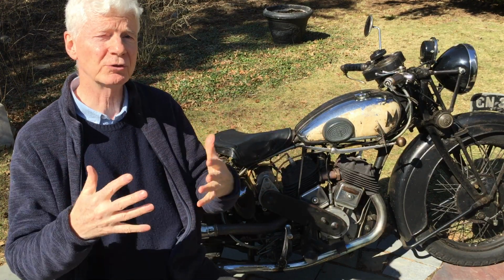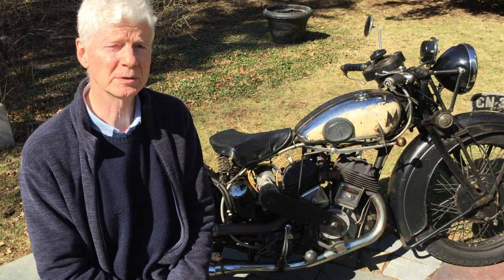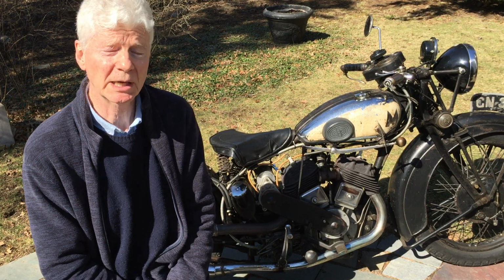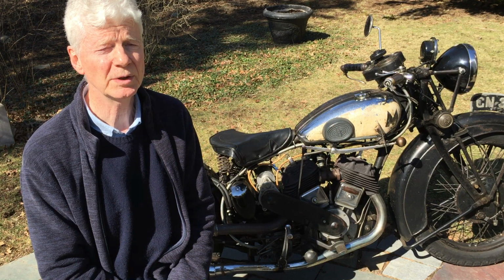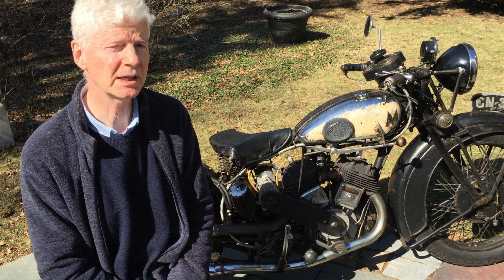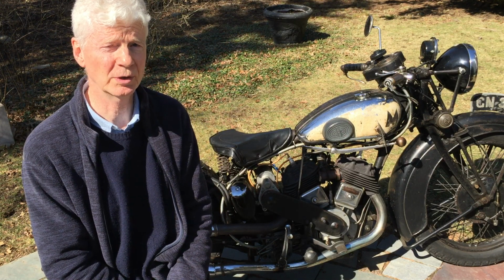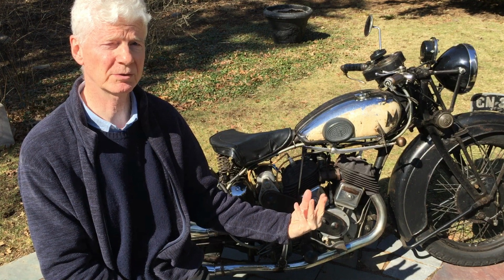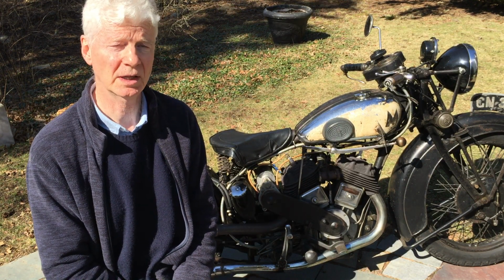So why should we care about this? Well, it's a mistake many owners of older motorcycles make. So perhaps now you can avoid it. But also it has to do with me, expecting an old motorcycle to behave in the same way as a modern motorcycle, with its highly efficient oil pump, usually right at the bottom of the sump. It doesn't. It wasn't designed that way.